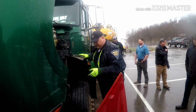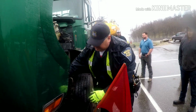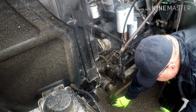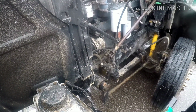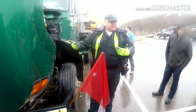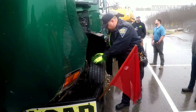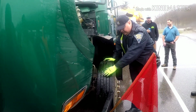So look into that. We're coming down, we're checking the steering components. Like I was mentioning, dry powdery rust. If you looked in and saw some dry powdery rust around these components, those are supposed to be good and tight. They're not supposed to be moving. But if you see the streaking, that's an indication something's going on there. Front tire here, we're checking major tread grooves, obviously for any cuts, defects, wear.